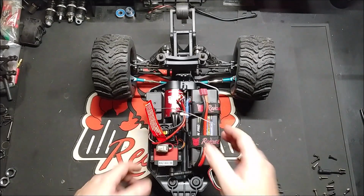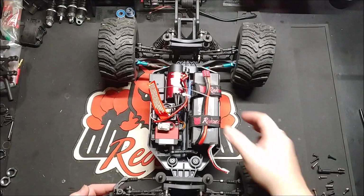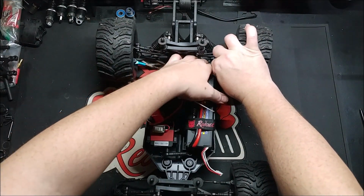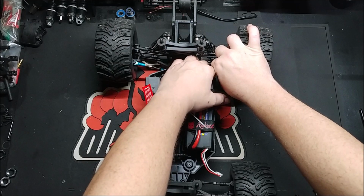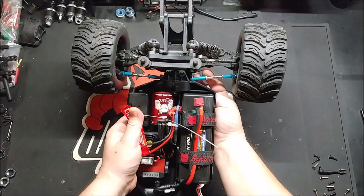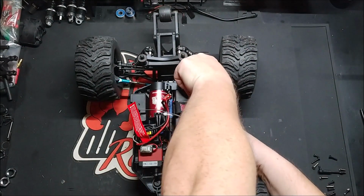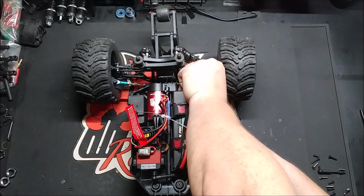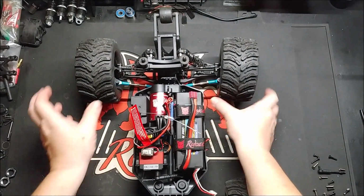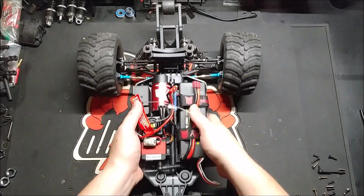But yeah, we got some complete sag here. We're going to definitely do our shock oil before we get this thing back out. But other than that, man, we'll see now that we know the aluminum fits. I'll keep an eye on that. And if it becomes an issue with the other ones or the links, or if we just want to do them and have them all look good, that is an option. So these things are adjustable a little bit too much here, because I got that double adjustment. So I'm thinking thread lock's probably going to be the way I go, because this might open and close on its own while I'm driving, but we'll see.